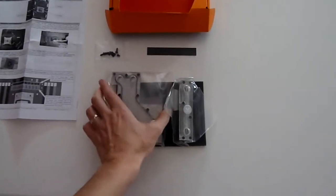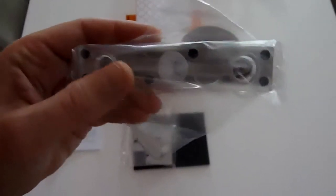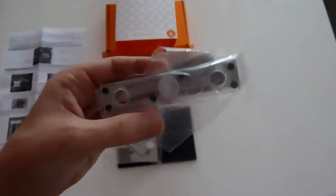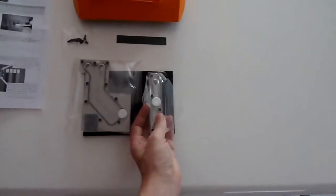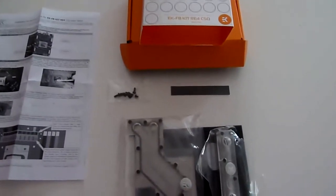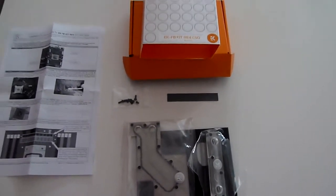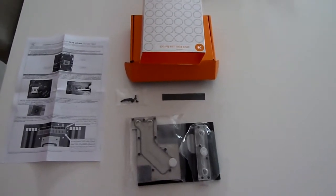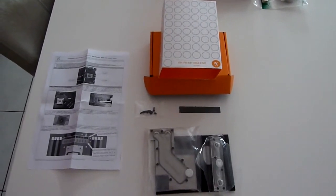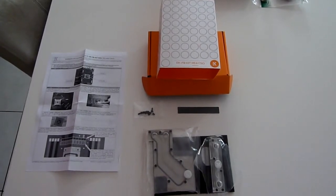And this is the water block for the motherboard chipset. According to EK, you won't get any better temperature than the default ASUS stock fan. But this little fan runs at 5000 RPM and it's very very loud. I had to reduce the fan speed up to 50% for decent noise, and my temperature increased as a result. So with this water block I will no longer have this noisy fan, and my PCH temperature will decrease. So I think this water block was the best choice for me.